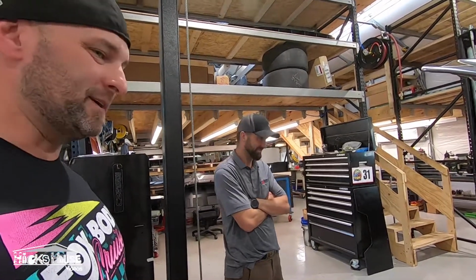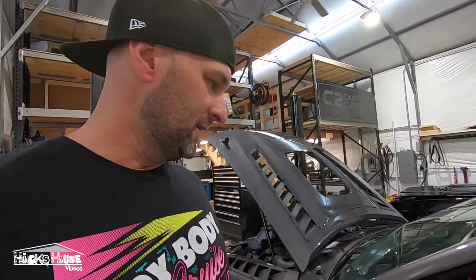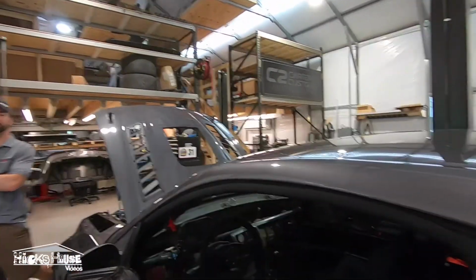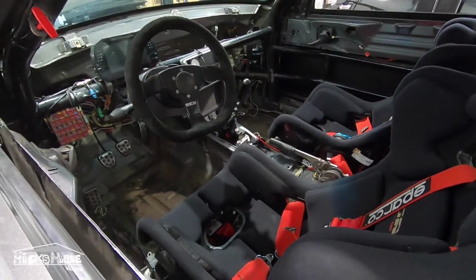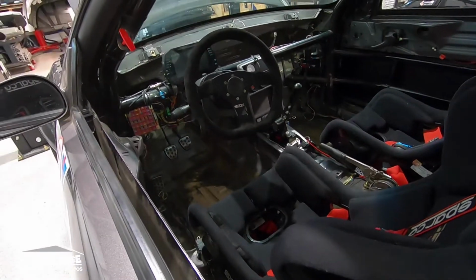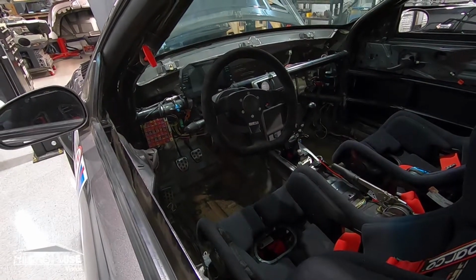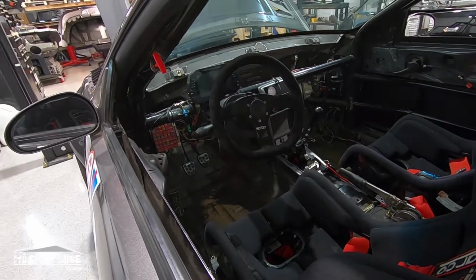I went back to automatic for a little while. Yeah. But yeah, I've been looking at these shifters. I really like them. So I've got a Tremec back in now. It's just a regular. It's the old TKO. It's the 3550 TKO. Yeah. But that shifter is so cool. Yep. I cut a lot of the floor to prevent from having to take the transmission out to do the install. Okay. I highly recommend pulling the transmission.